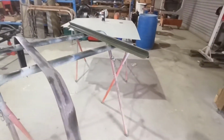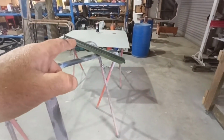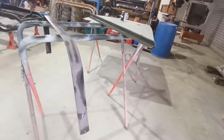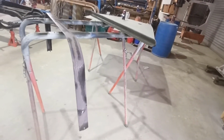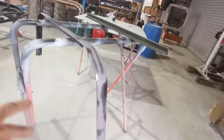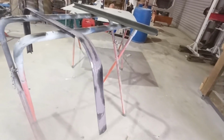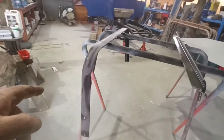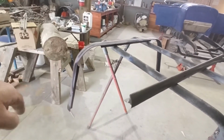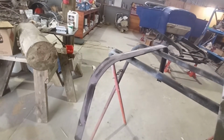so those two pieces are cleaned up and almost ready to go for primer and whatever. So that one there, once it's dry, I'll just give it a light scuff for primer. This one here needs to dry, and then we can DA the outside of it. I want to make sure it's clean, and obviously over the edge a little bit. I'm not too panicked about the inside of it. We'll just give it a light scuff with some sandpaper or something, and then we'll prime that. I might etch the outside of it and then prime it, because by the time I etch it, it'll probably take a lot of that rust converter stuff off, but it'll still be in the pores, so it's funny crap.